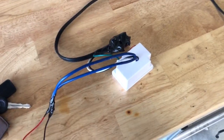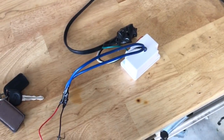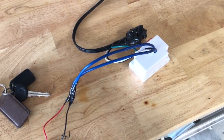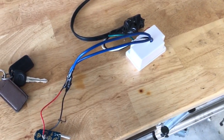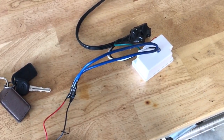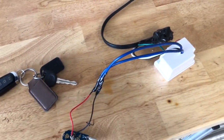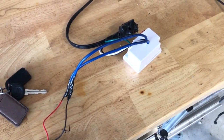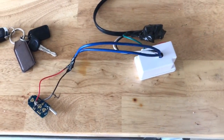You have to do it from your desktop. You go into the SmartThings IDE, find that device, edit it, and change it to a contact switch. I'll have to put the details for that, what type of setting to change this to, but essentially we're changing it to create a pulse signal. So it's going to turn off and turn on automatically in one step. When you turn it on, it'll turn on for about 3 seconds, send a signal for those 3 seconds, and then turn off. And that's all something that can be done without any programming or anything, all within the SmartThings IDE.